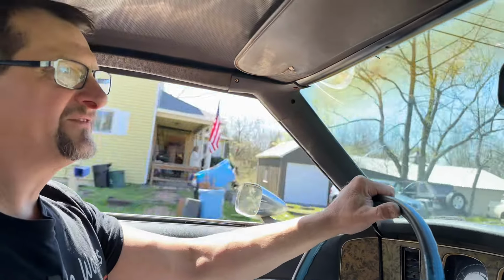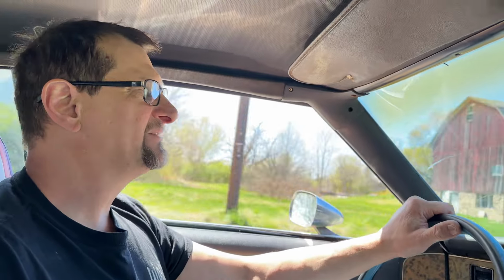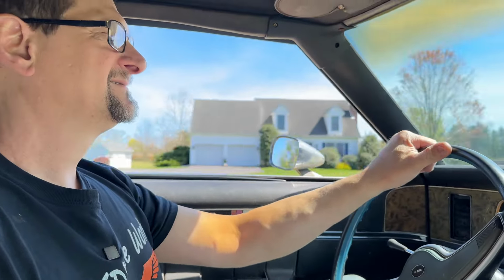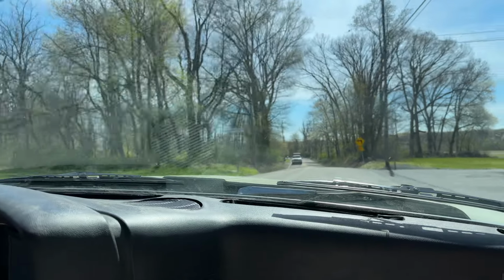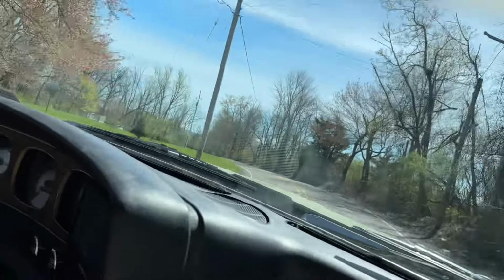So during that transition, I built the Ford 9-inch rear with some good axles, 355 posi. Got the radials on there, the drag radials, help hold the power down. Got a manual valve body in the transmission. Eventually it'll get a 4-speed automatic that's built to take the power a little better. Fun cruiser car. See if I can find a place to open it up and let you guys see what it does. Like I say, it's got a 3-inch stainless steel exhaust system that we got from pipes and modified to fit the car, with a set of 2.5-inch stainless steel tailpipes and flow through mufflers.